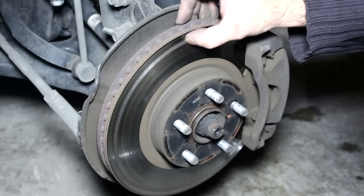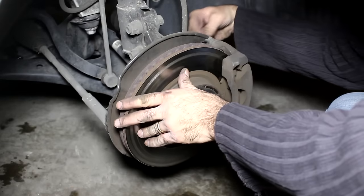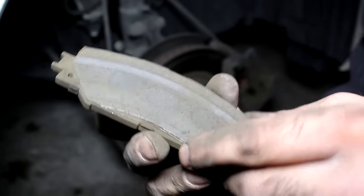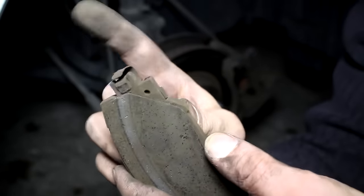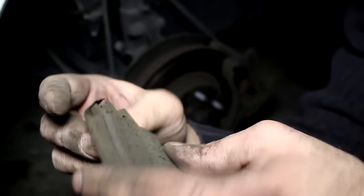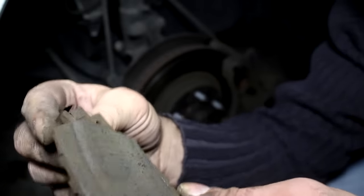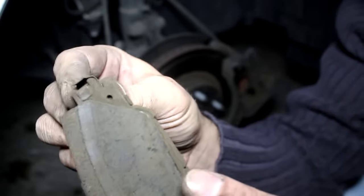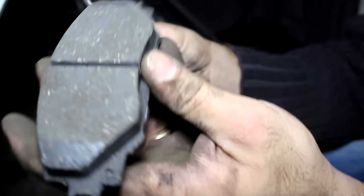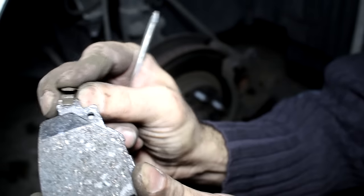Look at this — I'm a little bit late. There are traces of grinding on the disc, but it's not too bad, it's just the surface. Wow, the pad is pretty flat. See, that crack on this one is completely gone. This is stupid though — you see this piece of metal here? This is responsible to grind against your disc and make that squeaky sound. It works as an alarm to tell you that your pad is done. But instead, this thing is just grinding on my disc and wearing it away. It should really make the sound instead of grinding it. And see, this is the brake that I changed three years ago. Actually, it had some juice left in it. Well, it doesn't matter. I have my brand new brakes from three years ago that I can use. I just take that piece of garbage alarm metal and connect it to this one so that it grinds my disc when it's almost over. And just remember, there is probably a lot of lead powder around here so don't sniff the powders too much.